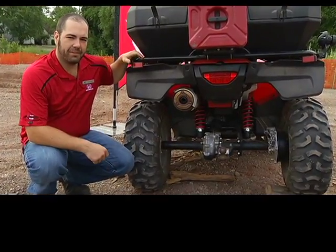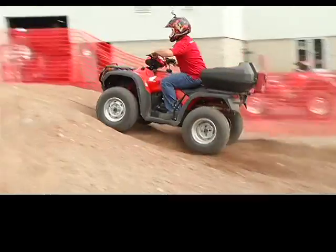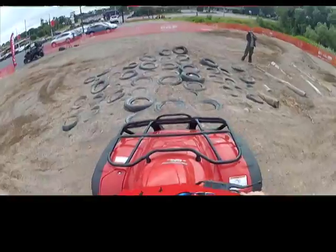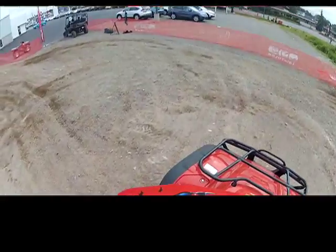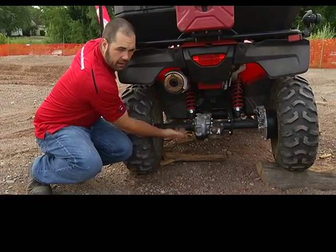Solid axles on off-road bikes such as ATVs have been around for a while. This is your traditional axle that you find. This is a work-geared type of suspension. The ground clearance between the tires and the axle never changes. Doesn't matter how much weight you put down on here. On independent rear, you put more weight on the back, they squat and you start to lose ground clearance.